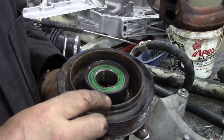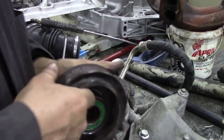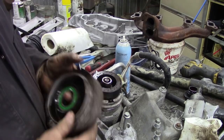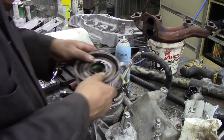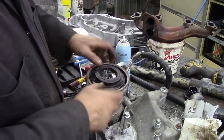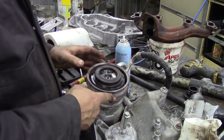I'm wondering if it's just rust built up on the inside. It actually feels nice. I'm going to clean this up with some emery cloth inside and put it back together — it might not need a bearing, it might just be rust because it's been stood for a long time. Let me explain how it works: this is an electromagnet here, and the wire on the side receives a signal from the air conditioning. The belt spins this freely, and when the electromagnet engages, it pulls on a flex plate — it's called an electromagnetic clutch — and it clamps up when your air conditioning is active.